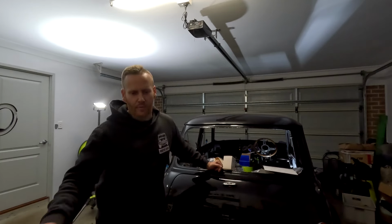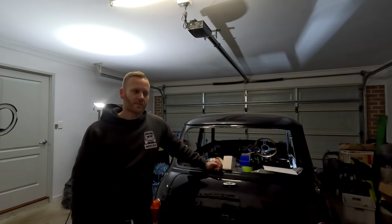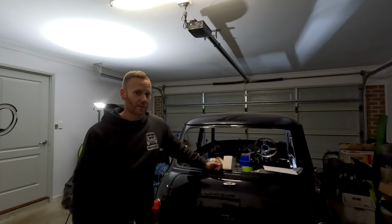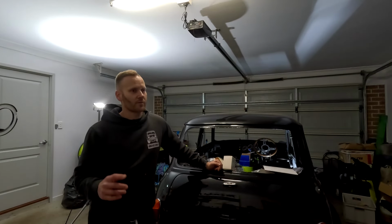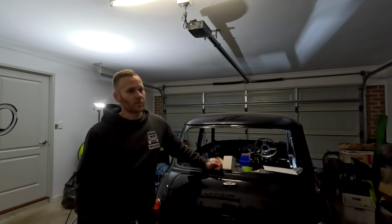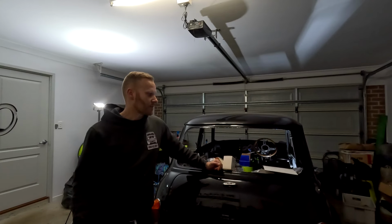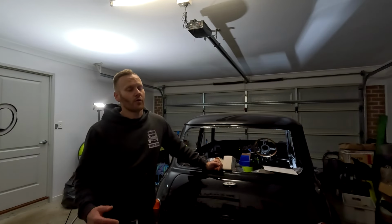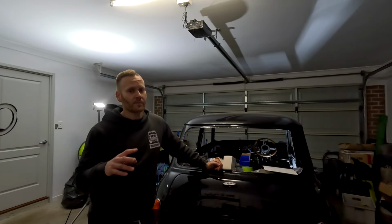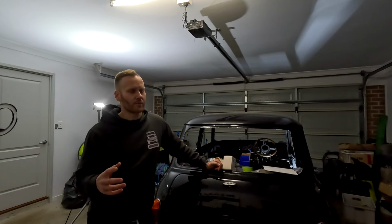Essentially, the brakes are bled now, and what I'm going to do is I'll probably get Kev to come around and just give me a hand to finish bleeding them off. Just to make sure, because obviously when the car is stationary, the brakes haven't been bedded in properly as well. They do need readjustment. There's a lot of factors. The car's on the ground, it doesn't have a booster, all that sort of stuff. It is worthwhile noting that until you take it for a test drive, you're not really going to know, but you're going to know pretty well straight away.